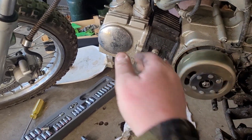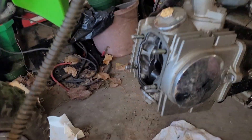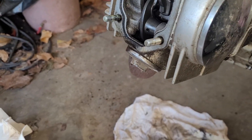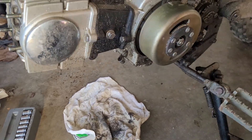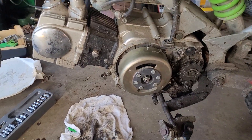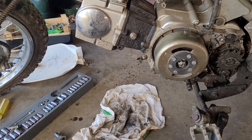The engine turns and the engine has compression. I took the valve cover off — both valves are moving. It did actually spit out some oil, so I had it cranking over with the drill. Let me take the spark plug back out so the compression is not fighting me.